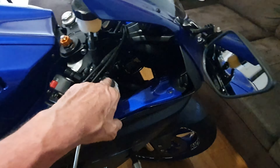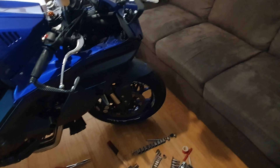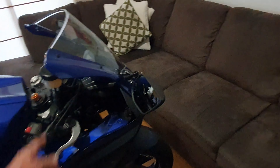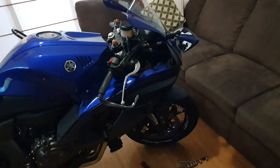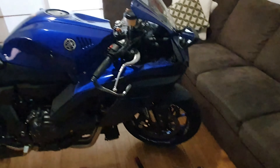By the way, the clutch on this thing is so light. I think it's because of the slipper clutch — you have light springs. That's gorgeous, that clutch. But that master and those front brakes when I was at Willowbank — bloody brilliant. Honestly, even though it's a rubber line, I got a little bit of fade, but nothing mental, nothing bad like the R1. That thing was awful.